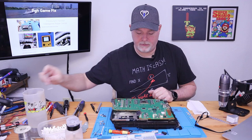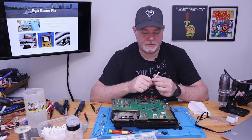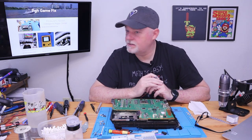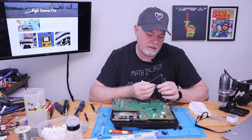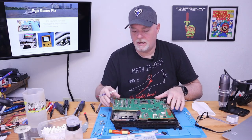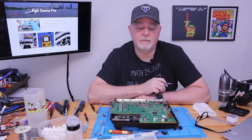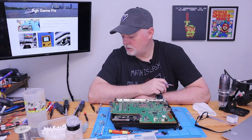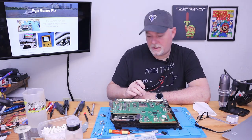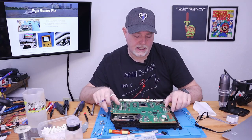Now we need some thermal compound. Now this is one thing that people, there's a lot of debate, different types, Arctic Silver. I carry some of the specific brands if somebody asks for it. But really any known good silver-based thermal compound should be fine. I recently just got two Xboxes in that were shorted out from somebody just glopping it on. You'll see a lot of guys saying you put it on, you use a credit card, and you do a smear and you make it perfect. And well, you saw from the factory, that wasn't the case. That's not how they do it.